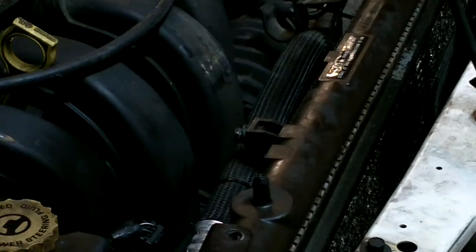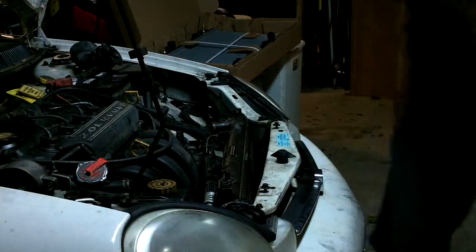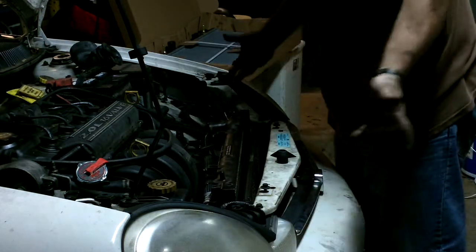I'm going to remove them and show you when I pull the radiator out. That's the hood of the car down here at the bumper. This bolt right there — that's for the air conditioner condenser mounting bracket. There's a second one right here, just on the bottom of the radiator. Once I take that one off and that one off, the radiator will slip right out. It would be nice if they told you that in the book. We've got the bottom bolts off, the air conditioning condenser bracket pops forward — how easy is that when you know what to do?